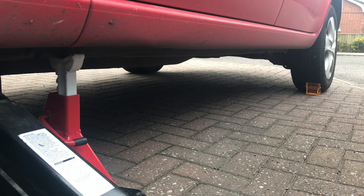That's pretty much what I use. For your DIYs — brake jobs, a bit of working underneath — use your jack, use your axle stands. Take the tire off and put it underneath the car as an extra safety measure to stop it falling on top of you. You are paramount here, and there isn't a lot of help out there if it goes wrong, especially with this coronavirus emergency. Hopefully this helps gives you a better insight for jacking your car up safely. Thanks for watching — keep safe out there.